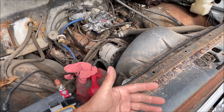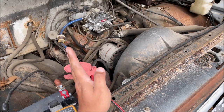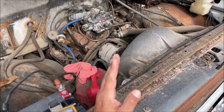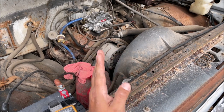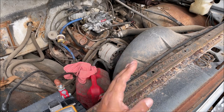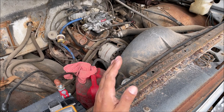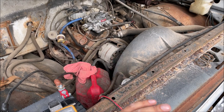Look up the range for your alternator - I think this one's 13.5 through 15.2, but I usually see them charge around 13 to about 14.5. That's the range I've always experienced. This is the first time I've had one this high, and if it's high like that you need to shut it off and figure out what's going on.